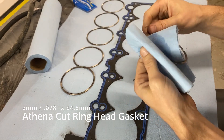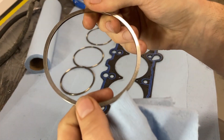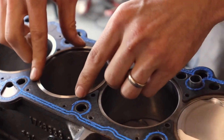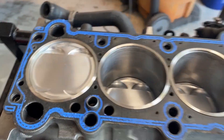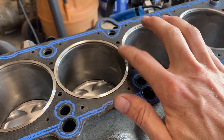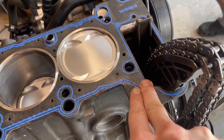These fire rings — you can see there's cuts in the top that sit into grooves created in the head, and then on the bottom it sits flat against the block. Make sure the ridges are all facing up as you do it. One thing I've learned is they never like to fully seat — they'll pop up, so you've got to work them into place and make sure everything sets down nice and flush. Our gasketed areas are sealed and we are ready.